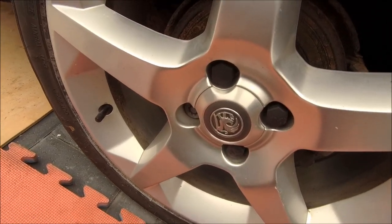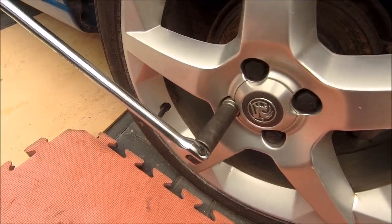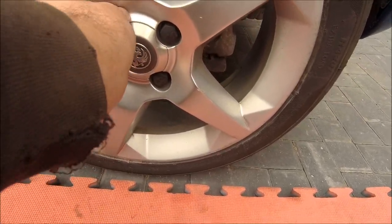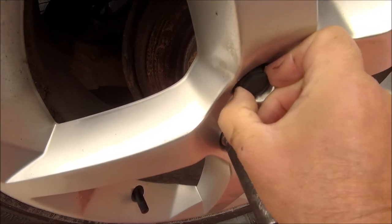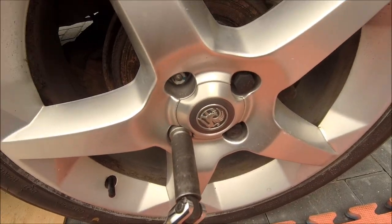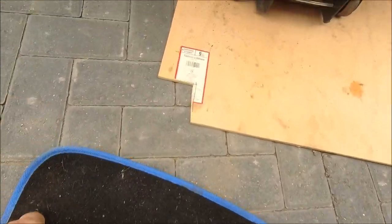First job: wheel off. There's a special wheeling-up thing in there and this is a 17mm — if you're taking your wheel off you need a 17mm, don't need a long reach, just a 17mm socket. Plastic caps — literally, these aren't easy to get off. You've got a tool for these in the original tool kit, but you can pull them out by hand, and then your bolts are behind there. Long-nose pliers work better.